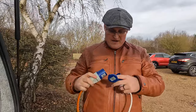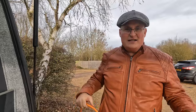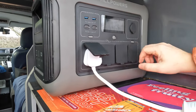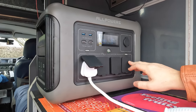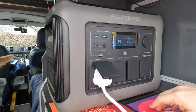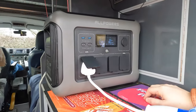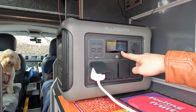I'm going to test something I've always wanted to test - I'm going to see if a power bank can charge the van. We're only going to do it briefly because I've not unwound the cable and it's a fire hazard if we keep it going. And there we go - you can see the van is actually charging from the AllPowers, and it's only drawing 38 watts of electricity. So if you just want to top up your leisure battery you could do that for 14 hours on this.